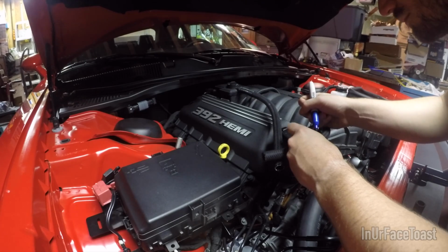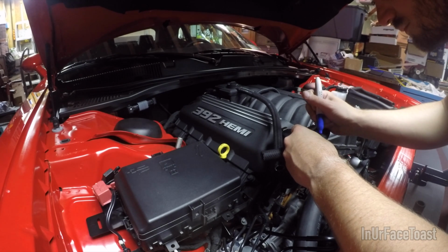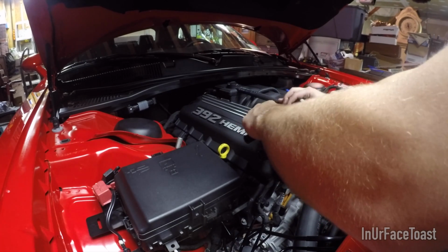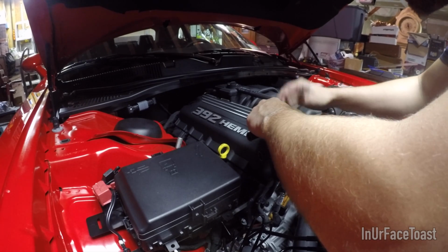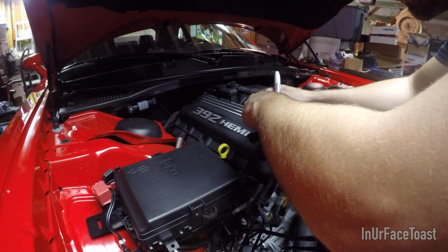So before you cut the hose, make sure you put it next to the inlet and outlet area and mark it with a Sharpie or something, and leave yourself a little extra room just in case you misjudge it. You could always cut a little extra off, but you can't add any on. So leave yourself a little extra room, mark it, and make the adjustments when necessary.